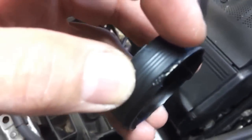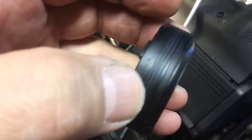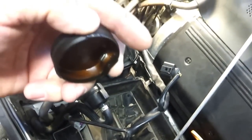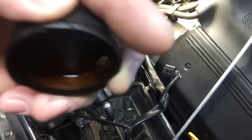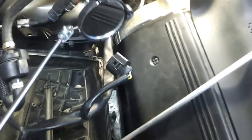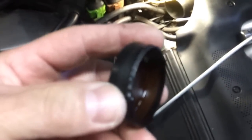There's debris in there, and if you look closely at the plug, you can see it's chipped away around the edge where the metal's exposed. Those pieces are still in that pocket on the cylinder head back inside there, so they need to come out. The spray will loosen it — you may have to get a small pick and scrape that loose stuff out. Make sure it's clear because otherwise the new plug will not seal properly. I'll take an inspection mirror and put it down in there with a flashlight to make sure everything's clean and all that plastic or rubber material is removed. It gets brittle and cracks off.